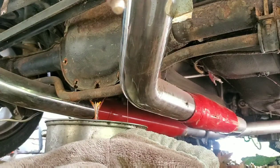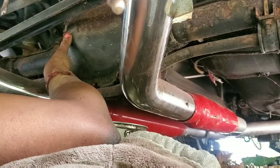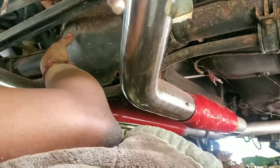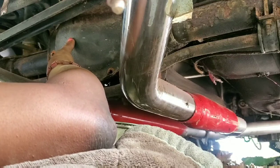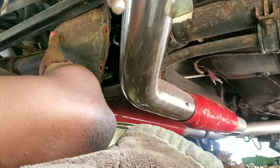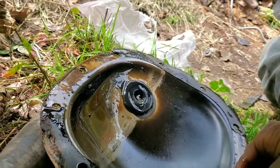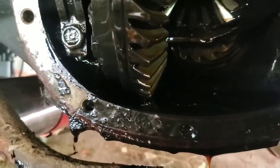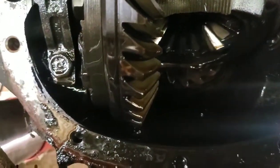There we go. Now we want to let it drain. It looks like it was new fluid. I carefully take it out using my hand, and slowly but surely take it off. What I'm going to do is clean this up — just old oil. The gears look like they're in pretty good shape. It is an open diff. We'll let that all drain, and once I get done draining, we can move the c-clips and everything else.